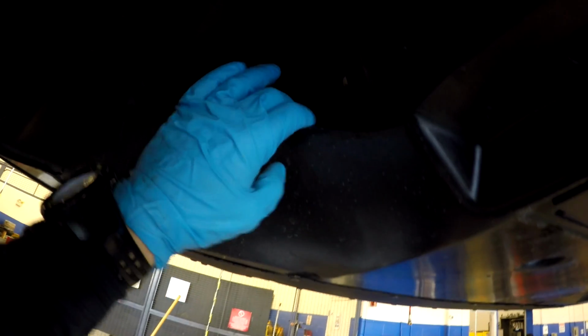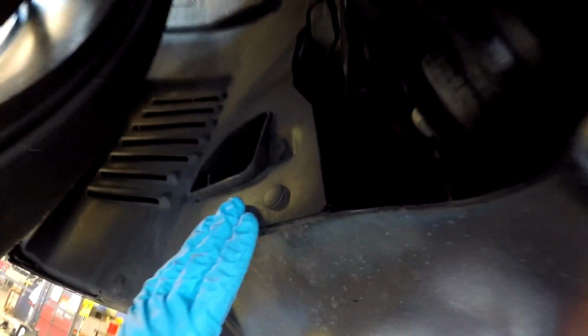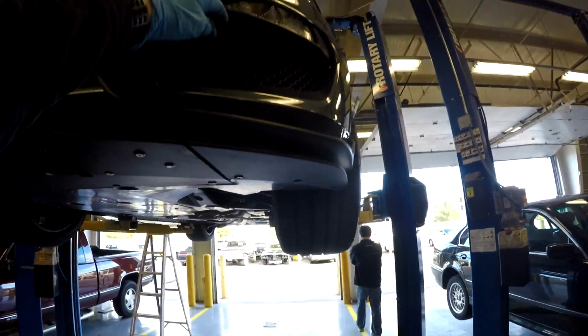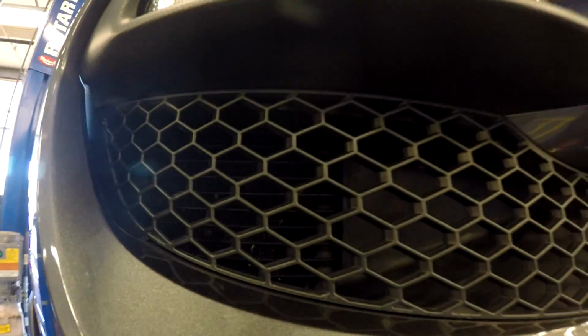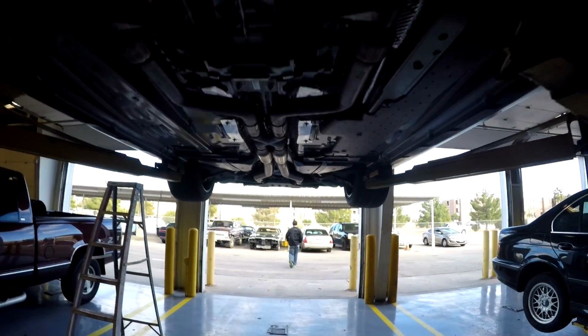And then over here on this side, you can see this is all boxed off. You can see there's the oil filter. The infamous one: gotta torque it down to 16 to 18 foot-pounds, otherwise it'll fall off on the track and start your car on fire, oil filter. And then you can't really see the lines for the cooler up front that sits right in here. This one on the driver's side is for the engine oil. And then obviously the one on the passenger side is for the transmission. So there we go, let's get this going.